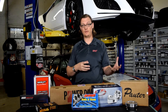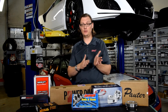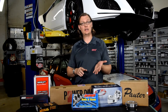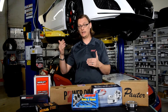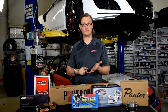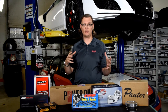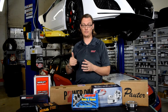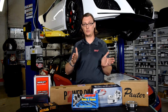When talking about power goals, there's a pretty finite limit to what a stock 2.5-liter Subaru block can handle. With a good tune, that's about 350 wheel horsepower. If your goal is beyond that — 375, 400-plus — then at a minimum you're going to need forged pistons, and the higher your power goal, the more bottom-end components you need to address all the weak links so you can make that power reliably.